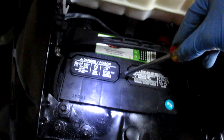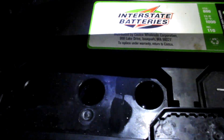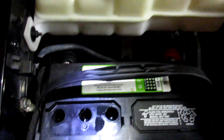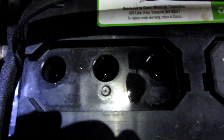Let's go check this one — maybe this one's low. This battery's out of warranty anyway. Oh, this one is low — a little bit. A little bit in that plate, a little low. We'll go top off this one. I'm thinking that one might be high on the other side just because I charged it. This one I haven't charged. But as you see when you look down there, the level is low. We're going to fill it up with distilled water.